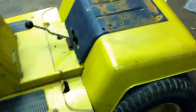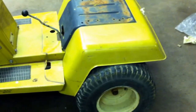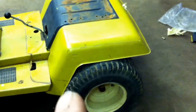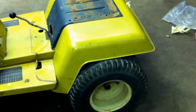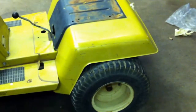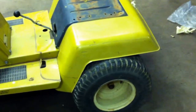All right, let's get grinding. So here we are, still in the rear fender drop. I've cut the center of the black out and I've got it down over the frame just to get an idea of what was going on. Now, I kind of like the way it's pushed back closer to the tire, you can see right here, and it's kind of nice that the seat's back some, but I'm too far back this way. I'm too close to the tire, so I've got to move it up some. I'm probably going to go back to the stock location and just put my seat as close to the back as I can when I bolt it in, just to get my distance back. That way I don't have to muss around and try to close the gap here or anything like that.